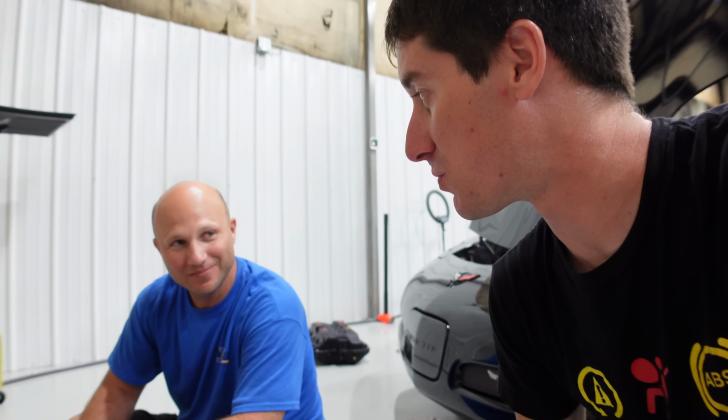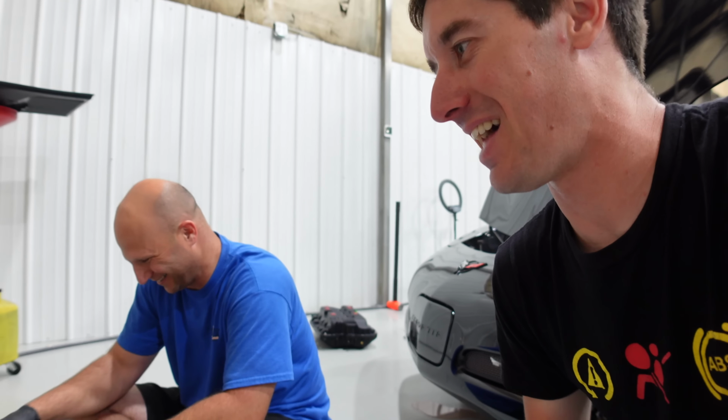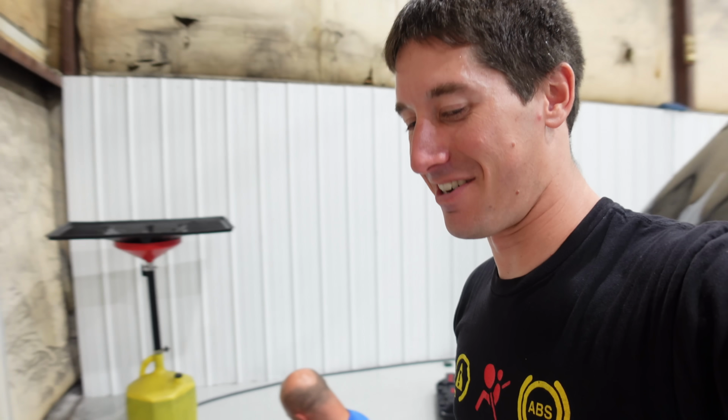If we change the motor mounts, we can do it. Yeah. I think if the engine lowers 1/4 of an inch, 3/8 of an inch, that'll open up enough room on the firewall. We're gonna buy some motor mounts. Just not today, because it's the last day we can work on the car. So unfortunately, we're stuck on the intake. Everything else is going back together right now.